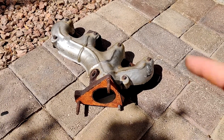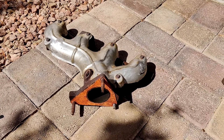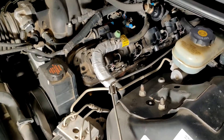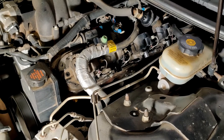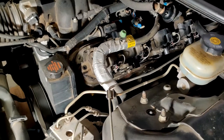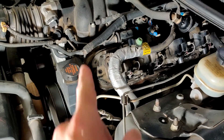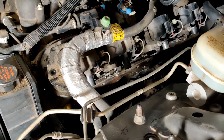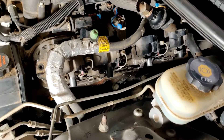I'm going to show you how I got the manifold out because it is not exactly easy. Alright, so back up top — underneath is straightforward. It's really the five bolts, and then once you get those loose, you've got enough wiggle room in the exhaust where you can move the Y-pipe back and then the cat will just come out. If you don't break anything, you just take the triangle gasket off the manifold, take the old one off, put the new one on there, put your new cat in place, run the nuts down, and you're done. But if you're like me and unlucky, now you get to take the manifold off.